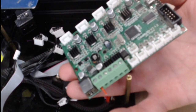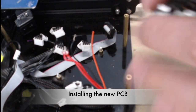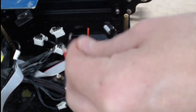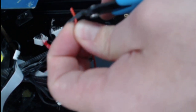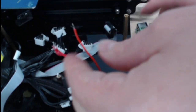So now we can send this board back with the return label or put our new board back on there. To put the board back, we want to line it up like this, and we're going to put everything back in all the way across. So if you had to cut one of these wires, we can go ahead and strip this tiny one right here — cut all the way around the rubber coating and then pull up. There we go, and now we've got the exposed end.